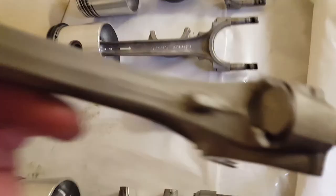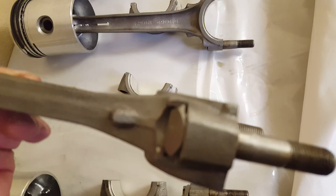This one's number three rod, and that'd be number four. You can see the small shoulder is going towards the middle main bearing. Then number two — the small shoulder is going towards the middle main bearing. There's your oil squirt hole, and your indexing mark is pointing to the front of the engine, with the t-slot opposite the oil squirt hole.